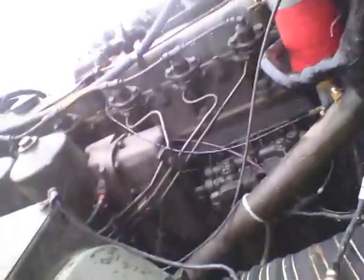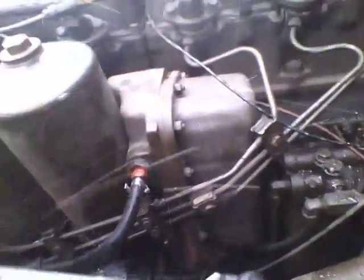And then I'm gonna start the truck up, because I had to warm it up. It takes a little bit for that thing to get going to the temp. Still thick. See, after I tied it into the oil sample port, and that's the feed line for the centrifuge. And now we're gonna fire it up so you guys can see there's no oil pressure change.